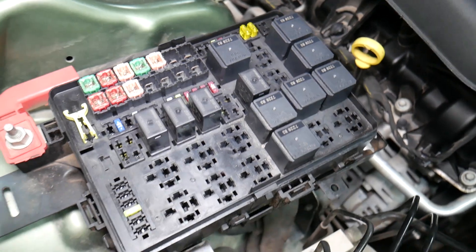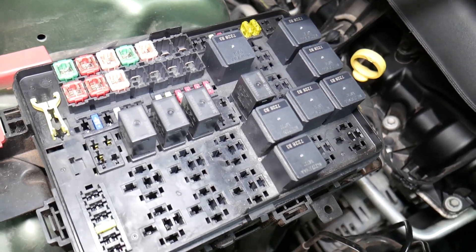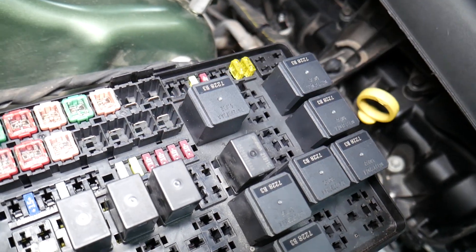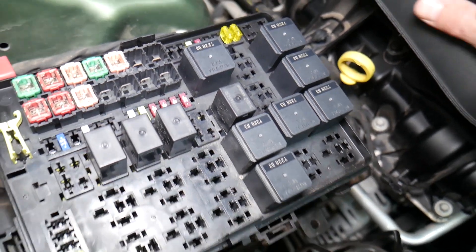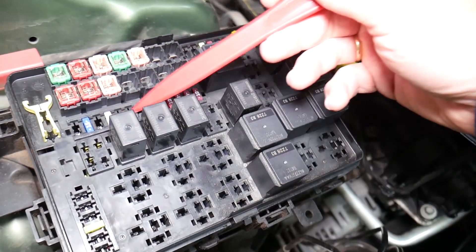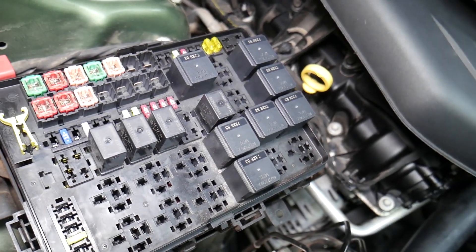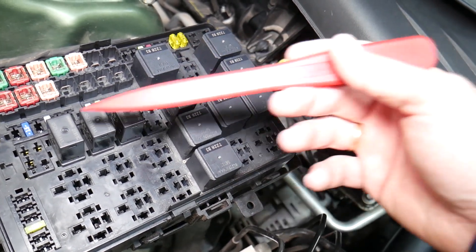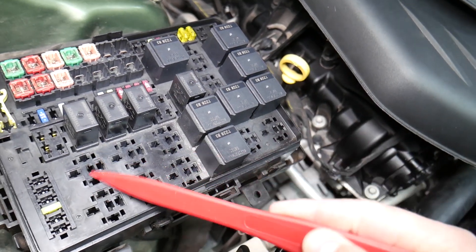It's super important to always test fuses and relays. A common mistake is assuming a fuse is good, or you may not be able to clearly see if it's burned. If you put a bad fuse back in, you'll end up spending money and time on parts you don't actually need. We'll put a link in the description on how to test fuses — it takes only a few seconds to know for sure if it's good or bad. The same applies to relays, which can be really expensive on some cars.